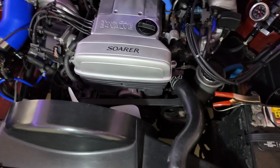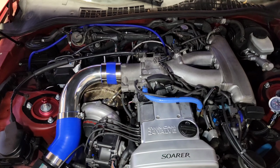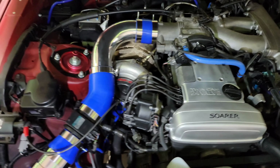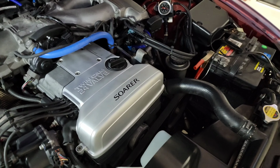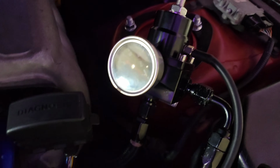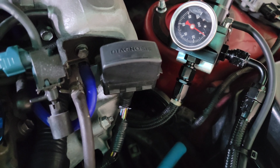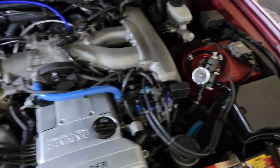If you're getting bounce between 10 and 0, that means the idle is too low, so you have to give it a little idle up to like 1,000 RPMs, and then you can get the right timing mark. Okay, now that we have all of this settled out, what we're gonna have to do is set the fuel pressure to, I'll say, 45 psi at idle.